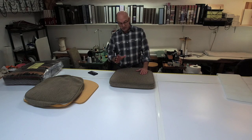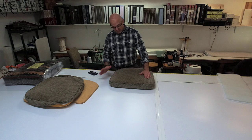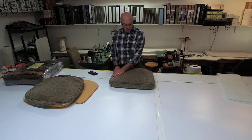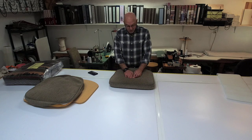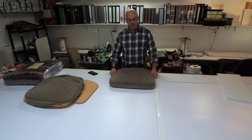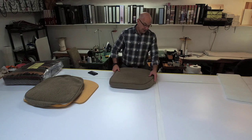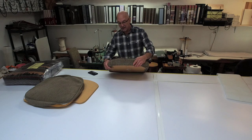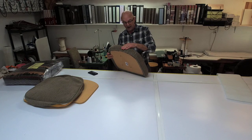So the first question is: do you really need to change the foam? Sometimes yes, sometimes no — it depends on the usage and what your foam looks like. On this particular one, the foam needs to be replaced. A few things to notice: there is no crown left on this, it is actually very flat. The fabric moves and I can grab it, so it is loose. The reason why it's loose is not because the fabric stretched — it's because the foam is now compacted. And you can also tell, especially when you're looking at the back side of it, that this is bulging round. This should not bulge round; this should be nice and flat in here.